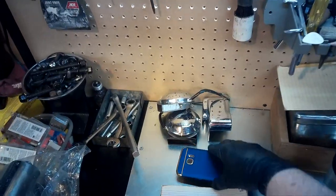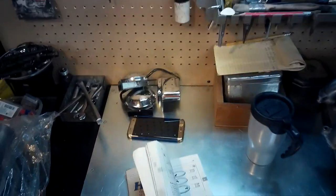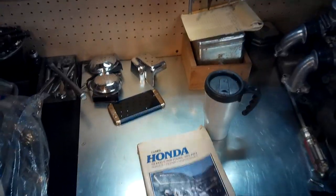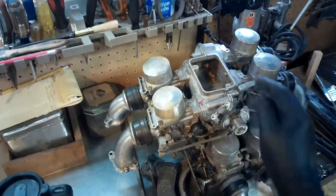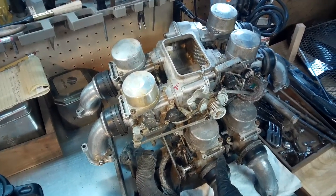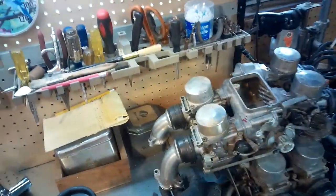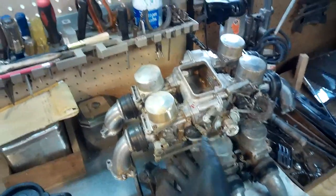Anyway, I'm going to get back to work. I just decided to take a break and figure out my next steps. That's the circlip, and then after that all the bolts are loose - it's just a matter of getting some guys out here to help me swap them. It's going to take a little while for the stator to get here, so first things first. These are the '81 carbs and these are the '83 carbs - I'm just going to clean these up with some carb cleaner, take the bowls off and see if they're in good shape. I'm going to go with these - they're slightly better carbs and the ports are smoother inside.